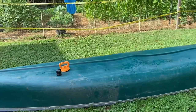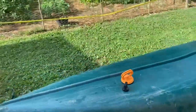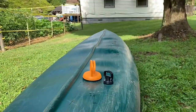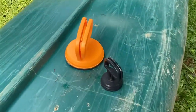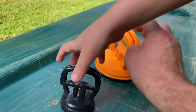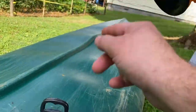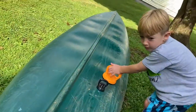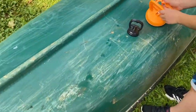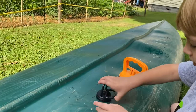You can see the oil canning all on it. That's not really going to affect it any way other than aesthetic reasons for me. And you'll see what I got here for my tools. I got some pullers that I got from Harbor Freight — I got a bigger one and a smaller one. Seven bucks total into this: five for the big guy, two for the little one. And then your old average everyday Harbor Freight heat gun. So what I'm going to do is get all this dirt cleaned off, wipe it down good, set the camera up, and show you guys how to get the oil canning out of here.